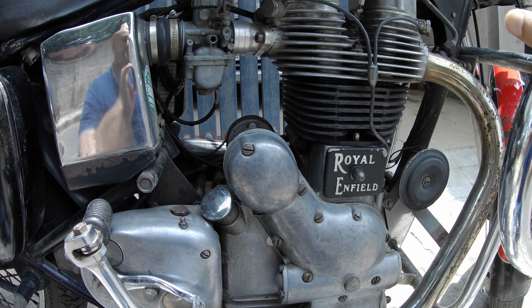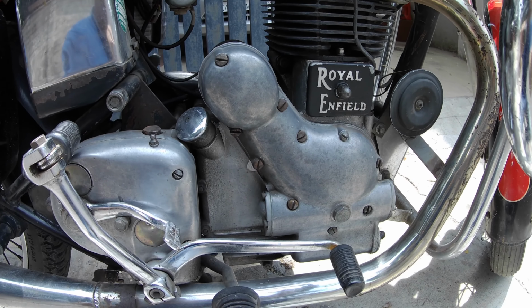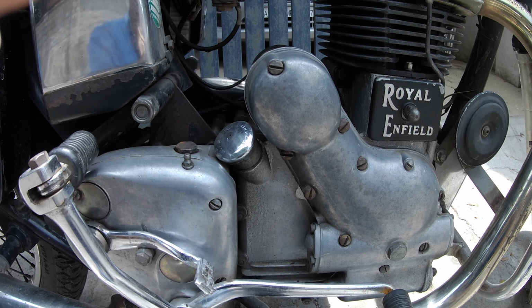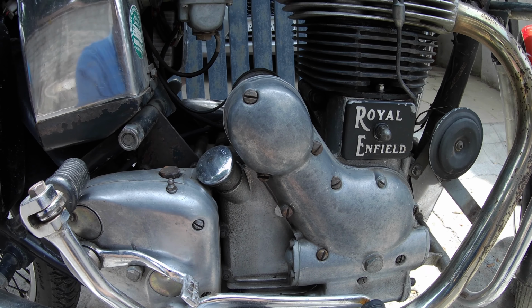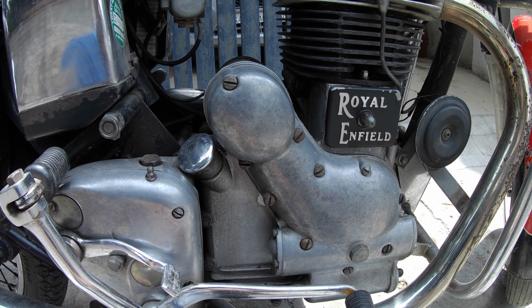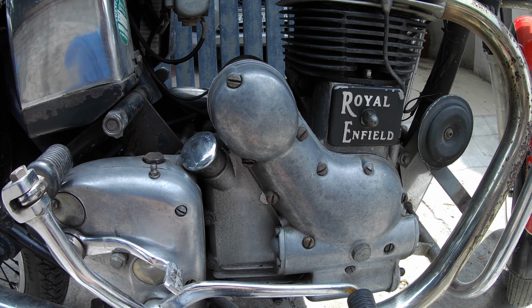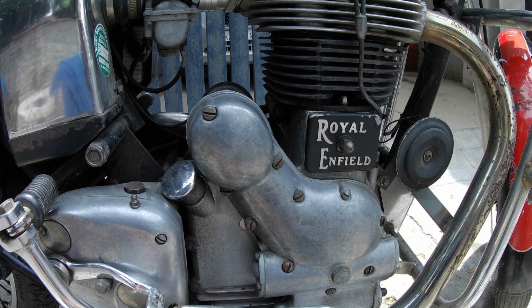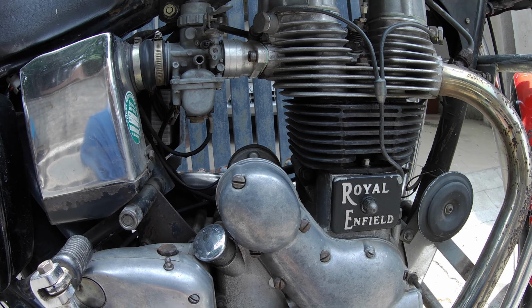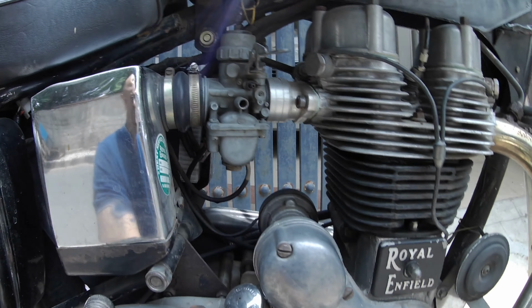So besides the engine block, which is pretty much changed, internally we have changed the crank rod basically. Besides the crank rod, I've also had the bearings on the crank changed, put on an imported set of heavier bearings to take the load of the engine. Somehow the torque seemed to always play up with the crank bearings, had a play on the crank shaft. I feel that this is one of the inherent flaws of the vehicle from when it was initially made.